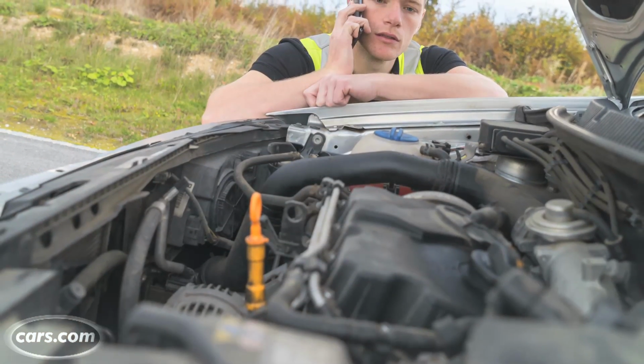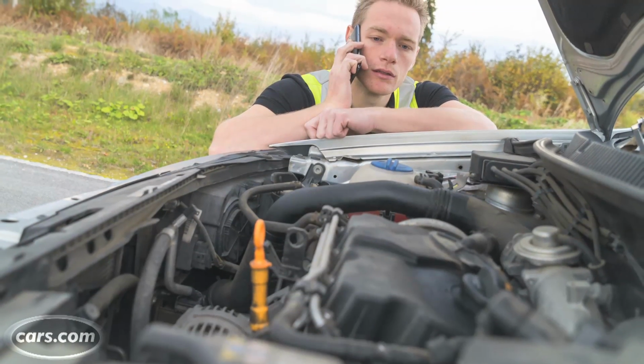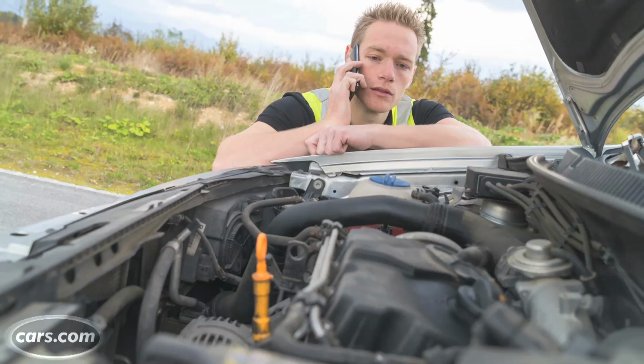Now, there's debate about whether it can be bad for your car to replace the transmission fluid at any point. We find this a little bit hard to believe. Typically what would happen is someone would start to have a problem in the behavior of the transmission, and then the first thing they do is what? Change to fresh fluid. Now, not changing your fluid can definitely cause problems in a transmission, but changing to fresh is probably not going to fix problems that are already there.